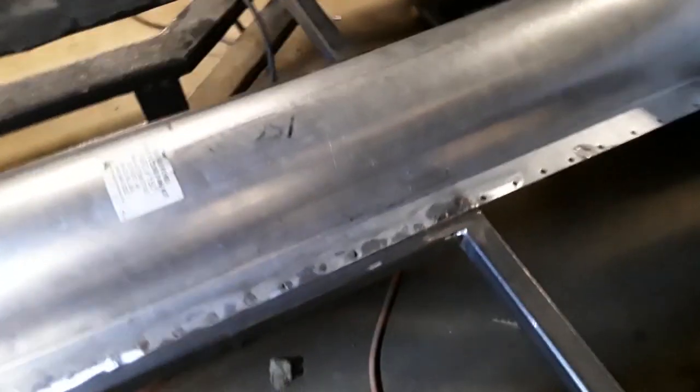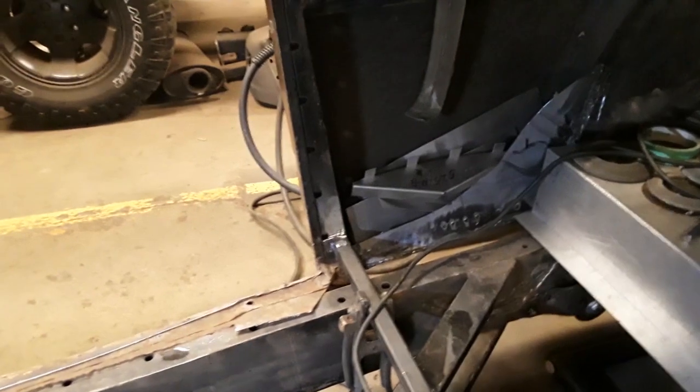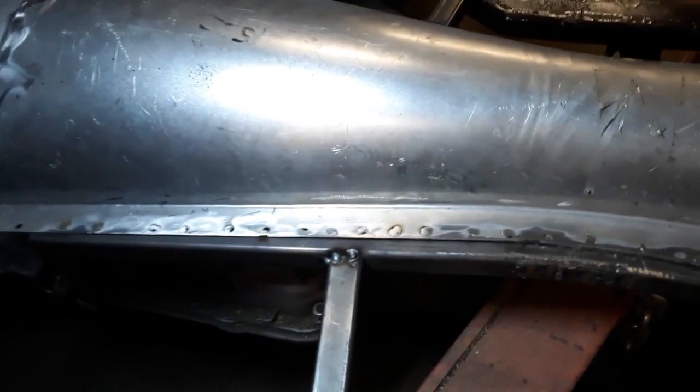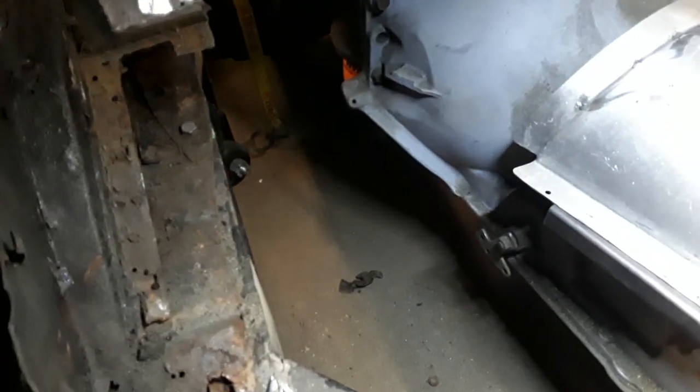Here's the other side done — turned out much nicer, I think. I have the tunnel welded in now. I welded it to this cross brace, which is welded to the B pillar, both sides. I've put these little wings on here — I don't know what else you'd call them — that's just to keep it from falling down on top of the transmission. They're just tacked in there temporarily to hold it in place while I measure up for my next pieces. The next piece is probably going to go here, which is sort of the base of the toe board, straight across into here on both sides.